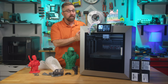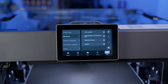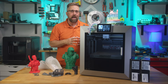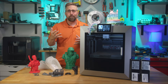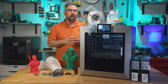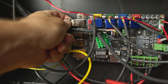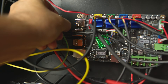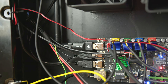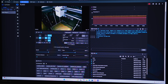The only reliability annoyance I hit was with the Wi-Fi. It's limited to 2.4GHz, and connection quality was poor enough that I couldn't reliably send files, check webcam feeds, or even load the print queue half the time. It does have an Ethernet port, but in my garage or basement that's not super convenient, so I ended up just using a USB stick. On closer inspection, the Plus 4 uses a pretty cheap low-gain USB Wi-Fi module, which explains the terrible bandwidth. I tried swapping it out with a better dual-band USB Wi-Fi adapter I had lying around, and the upgrade worked flawlessly — I connected to my 5GHz network with a fast, reliable connection and no dropouts.